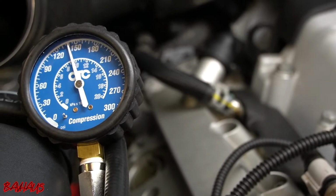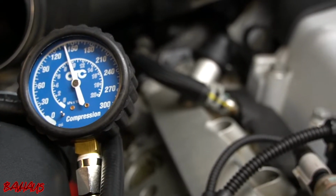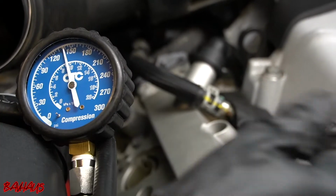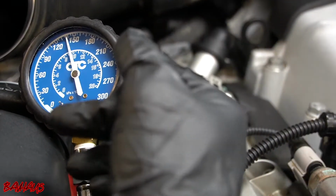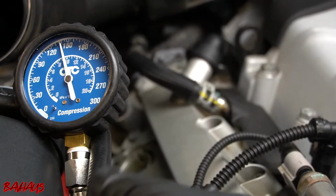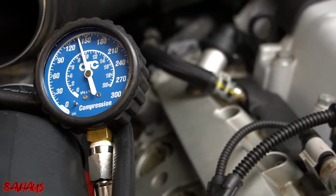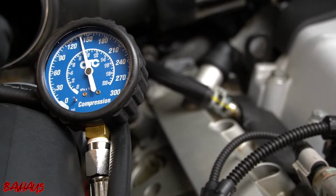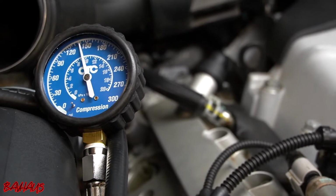I don't think I got the full 9 cranks on that first time. And another thing that I'm starting to also think is it sounds good. When it cranks, it doesn't give that bad compression sound. So we're over at about 140. So still not great, still not where I want to be. But again, everything I just said regarding there being a clear issue, this is good.